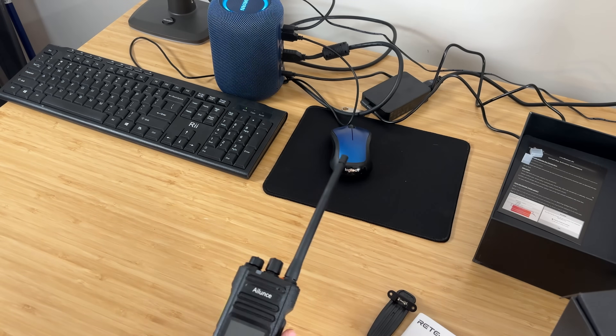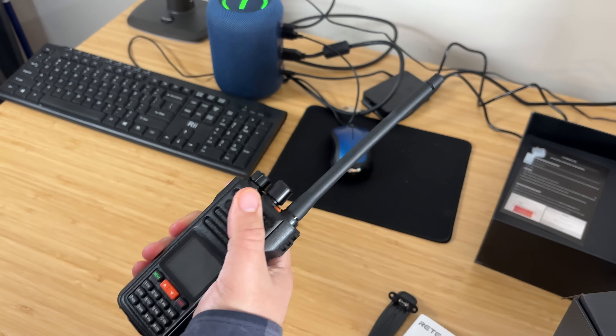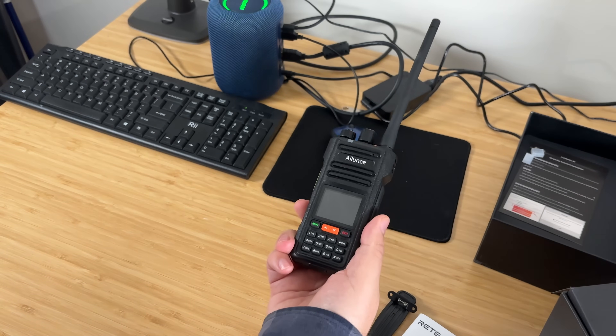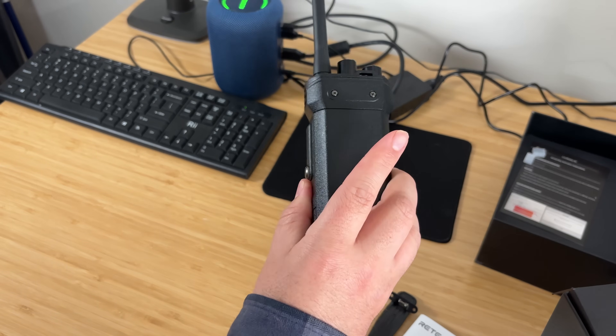Let's just talk about this radio. It's not like a toy radio — it's not like a certain Chinese brand. This thing is clearly designed to be kind of tough. I don't mind dropping it; it gives me confidence it's pretty well made. This is IP67 rated — fully dustproof and fully waterproof. It'll do submersion up to one meter for 30 minutes. It claims up to 10 watts of output on VHF and UHF — that's pretty high for a handheld, though it's going to drink your battery down fast. It does have dual band operation for common amateur frequencies, so you can do UHF and VHF.